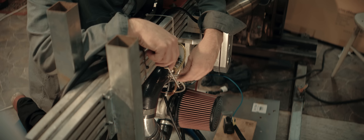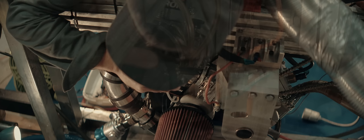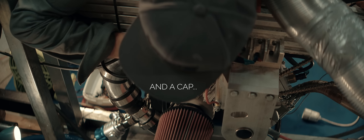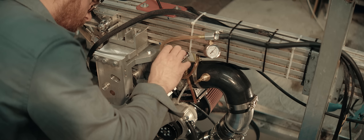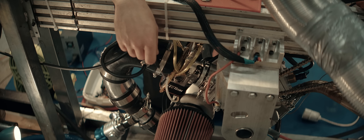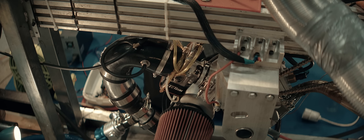This line is hooked up to a pressure gauge before the crankcase — I've got one in the crankcase and one here, but we won't be running this for now. I'm opening up my additional power jets again. Without that pitot tube we should get considerably less fuel at high flow and high throttle openings. We'll see.